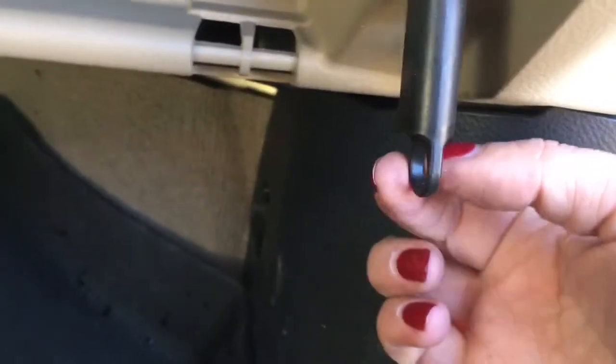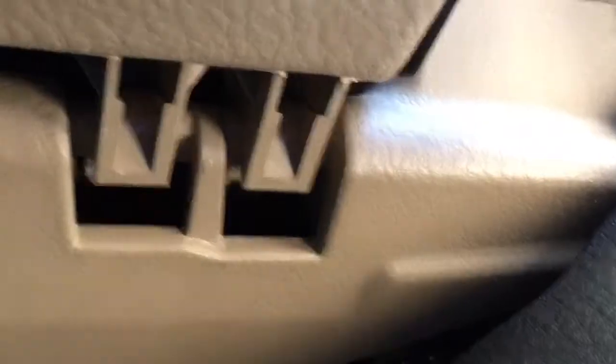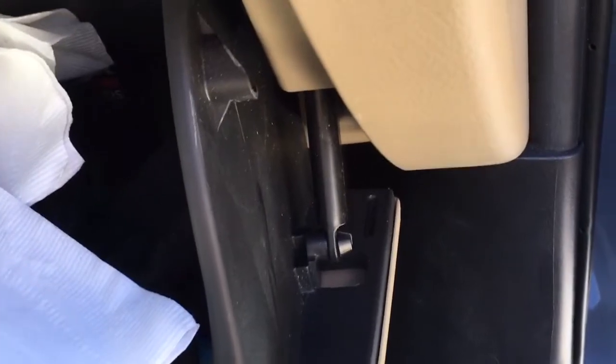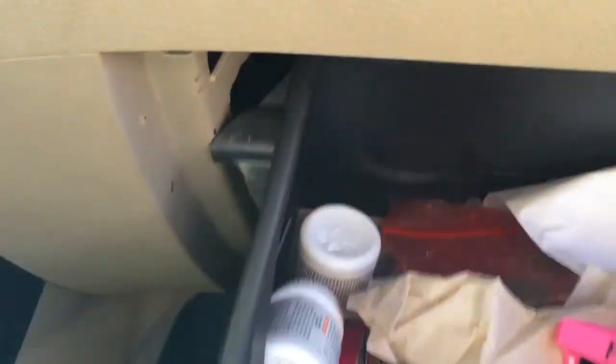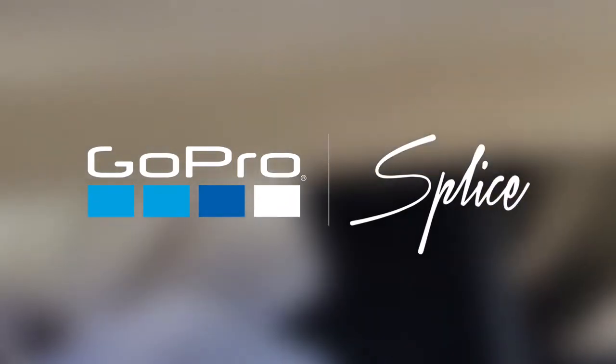Then you put your glove box back in. The glove box has these little hook guys that hook into these holes here. Make sure you get the piston into place, and then you can just pop it in pretty easily. Make sure the two hinges underneath are popped on where they're supposed to be so the door can open and close smoothly. Get your piston popped back into place, both hooks onto the little loops, then push it so these will hold it in place again. And that's it.